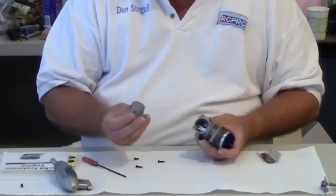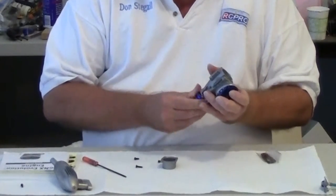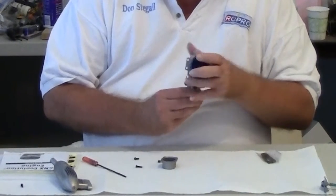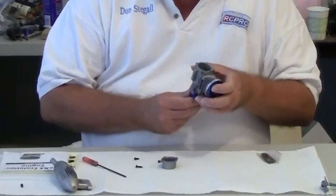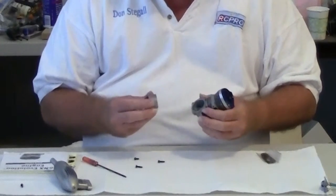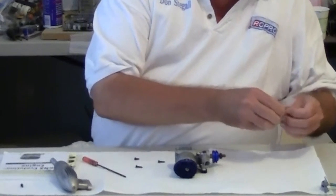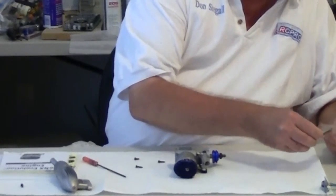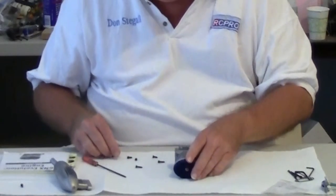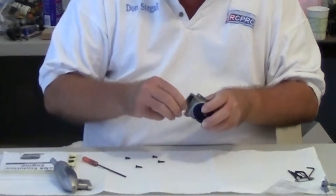Looking at the back plate, it has a piston skirt relief on it. I don't actually see the piston hitting an area but it looks like it comes very close. So I think if you're using a replacement Quickie 500 back plate mount to mount this engine, you need a back plate mount with a piston relief. Horizon provides two screws that are the shorter ones for the back plate mount so that you can take that remote needle valve assembly off and not have to get extra screws — which is a nice touch.